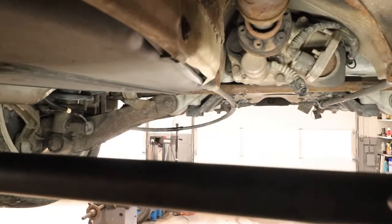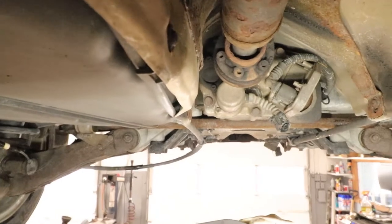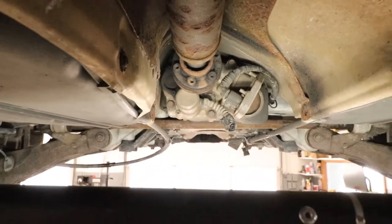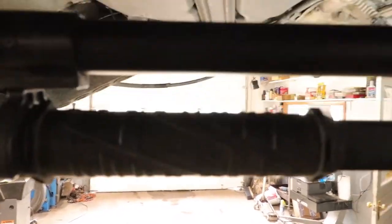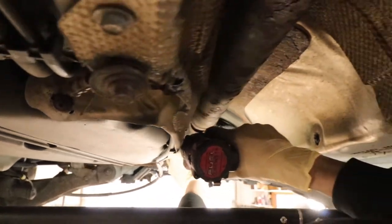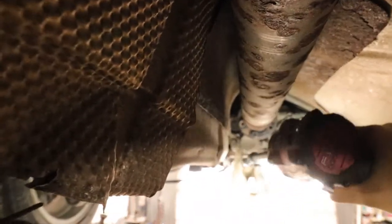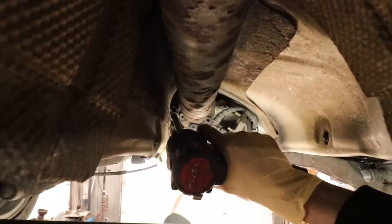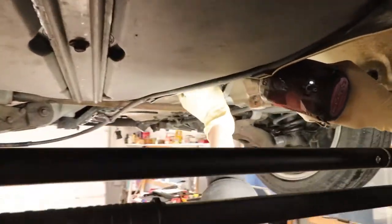Next is the filter. We're going to sneak up in there and do the two-bolt cover we were talking about. The bolts were fours — 4 millimeter. He already broke them loose beforehand. Easy enough to get in there with a wobble head, long extension — actually two wobble heads, compounding the angle, with four millimeters.